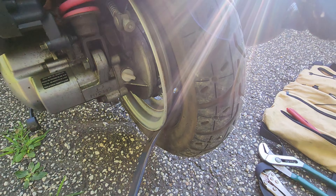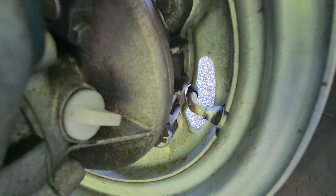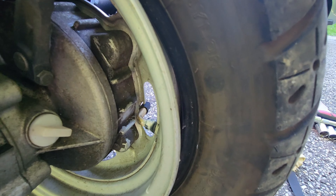We are the next day — I was having difficulties getting these into place. They were kind of squishy and mushy, so I froze them in the freezer. That's going to make the rubber a little more plastic-like, a little less give and squish to them, and it's going to shrink them a little bit — as any guy who jumps into a cold pool will attest to. That absolutely made the difference — this one went in first try. So if in doubt, freeze it out; go ahead and use some thermal shrinkage to your advantage.